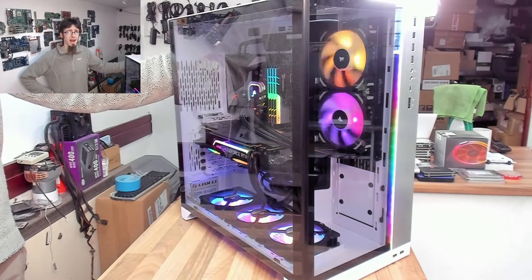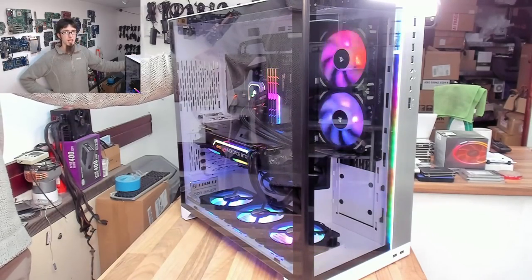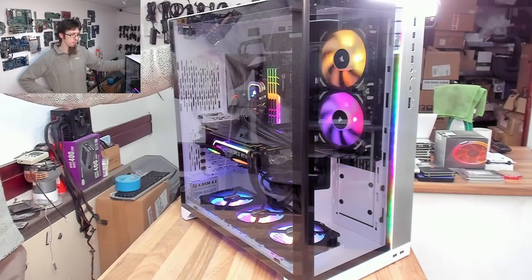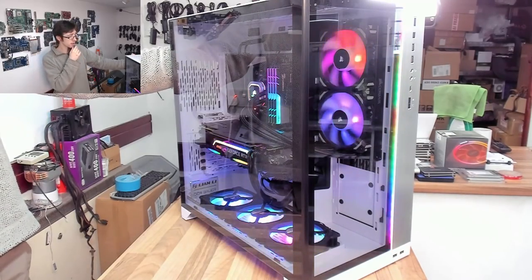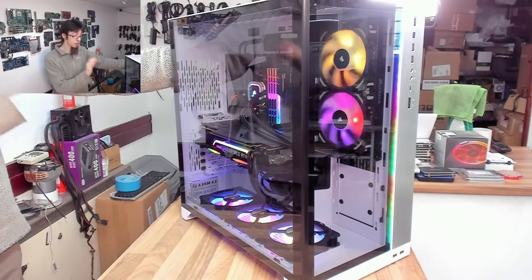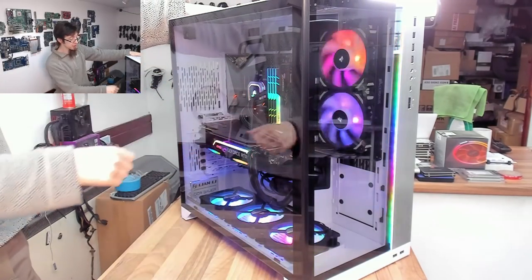Precision Boost is a weird animal, and sometimes overclocking can mess with your Precision Boost, which hurts your general single core performance, which can hurt desktop performance, and it's complicated. However, for the minute gains that you really get from overclocking Ryzen, I said to the client, honestly, I would recommend leaving it at stock and just letting Precision Boost take care of that.